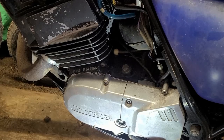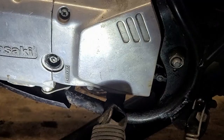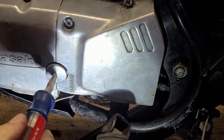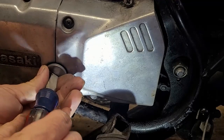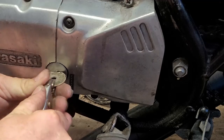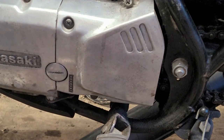These plugs can be a pain in the neck to put back on — they also cross-thread very easily. This next tip is going to help you out dramatically. What we're going to do is put this on going backwards first — watch, I'll show you. Go backwards so it gets into its spot, you'll see it snap in and drop right in. Then when it drops in, you tighten it and use your trusty washer. That's it — done — that's it for this side.